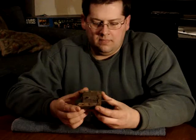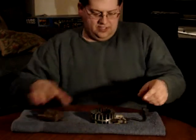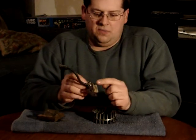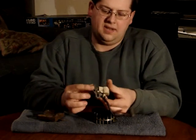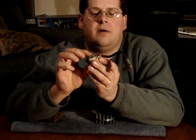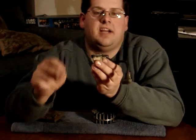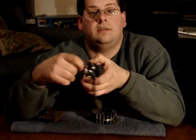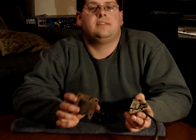I'll get into greater detail on the functioning with some diagrams in a moment. But basically, using this one as an example — this is the flywheel and magneto out of a weed whacker. This is an electronic magneto; there are no points. There's a little circuit inside, and basically how it works is as a voltage builds up to a certain point it fires at exactly the same point every time. The manufacturers have figured out the component values so it fires when they want it to. You have no control over timing with one of these, and when they go you throw it away. Whereas with the old style, if it doesn't start it could be the points — you can change the points and you may have spark then.